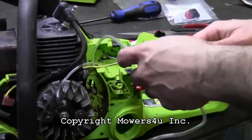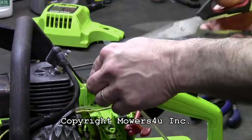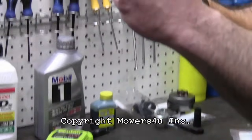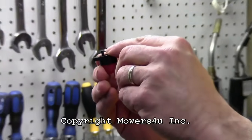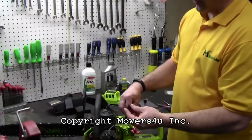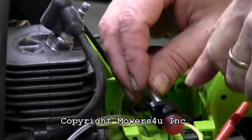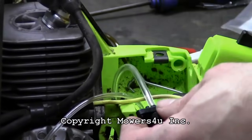Match the length of the old return line and add a little extra — maybe a half inch. Cut that line. On the new primer bulb, you have two fittings where the fuel lines connect. The taller fitting is the return — the out. The shorter fitting is the in. The return line goes onto the taller, longer fitting. It fits on nice and snug. Both barb fittings are the same size even though you're using two different fuel lines, so don't be alarmed by that.